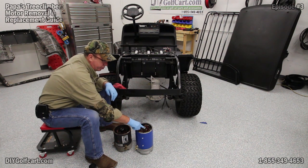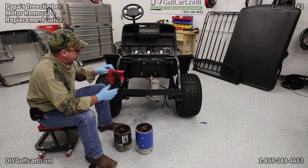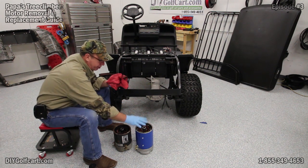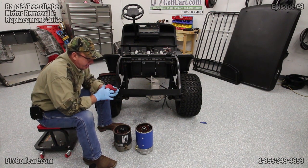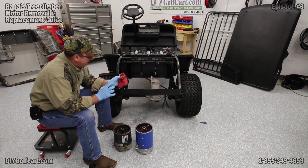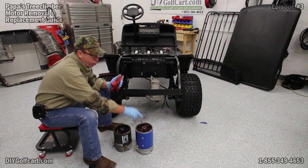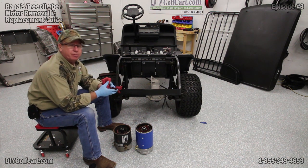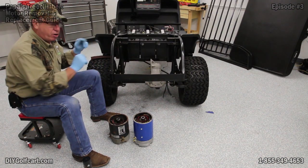The bushing seats right back down in the splines. I've already cleaned off the transaxle and pre-greased the outer input shaft and the inner portion of the armature. Now we're going to take this motor and put it on the transaxle — let's get this thing in this car.